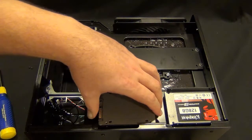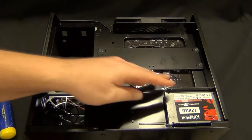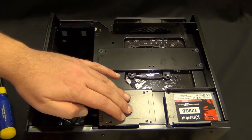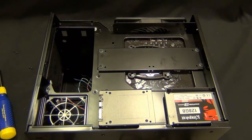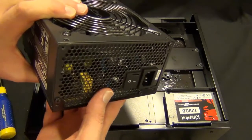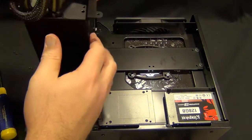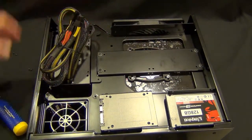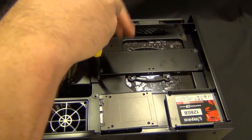Okay guys, so as you can see, we have the two discs in their little caddy here. The single disc is already installed. I'm just going to slide this disc in here and I'll attach that off camera. I may wait to attach this until I cable the single drive since it'll be a lot easier to get to. The power supply is a little adapter bracket that comes out. There are just three screws you're going to put in and then this just slides down into a couple of plastic rails — should be good for sound deadening — and then screws back in with two little screws.